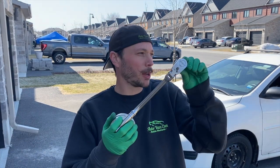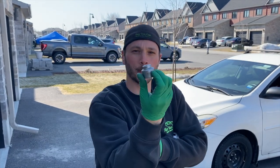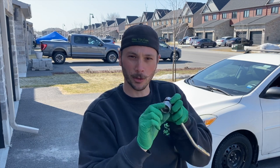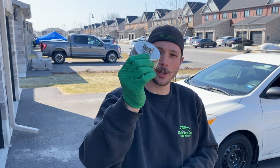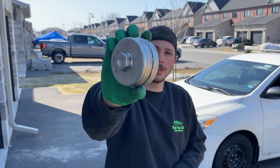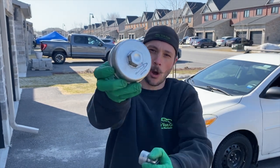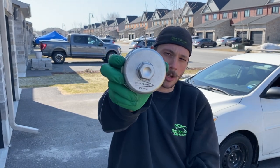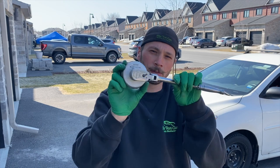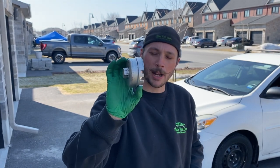Now onto some of the nitty gritty. You're going to need some ratchets — I have a couple of Snap-on ratchets here. I've got a small shallow 24 socket. You can buy these in a pack of five from multiple companies. As I'm working on a Toyota today, it has a specialized oil filter cup — this one's from Bluepoint, you can also get it from Nine Circle. That one has a three-eighth hole in it, where this one doesn't — it needs a 24 socket. This is what I'll be using to take off the oil filter. Again, you'll need an adapter for Toyotas; other brands will vary.